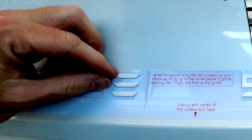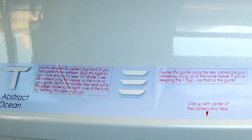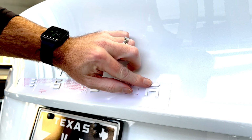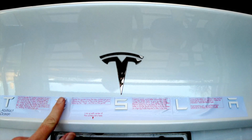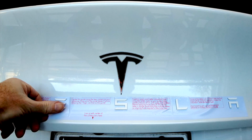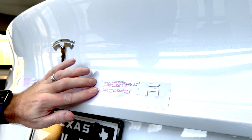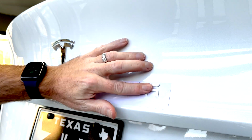We do sell these separately as well if you want to use one on your center console or your fridge or something. And last one, the hat on the A. Okay, so now take a step back. Just make sure, again, checking this looks well lined up and symmetrical, everything else looks level and set. And then if it is, then just apply a little bit more pressure. Doesn't need much really, it's just all of the 3M VHB tape, VHB is very high bond, all of the 3M tape is pressure activated, so just a bit of pressure is all you need.